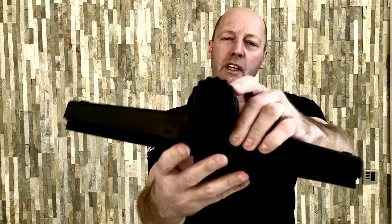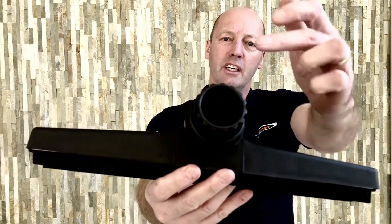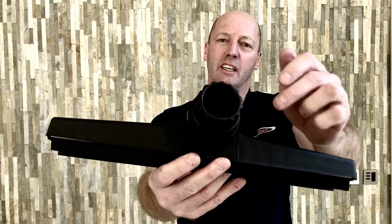On the actual inlet itself, the diameter across the centre there is about 38mm. When you actually push it onto your wand, this wand is actually about 35mm and it's beveled, so that will just slide on and then it locks on just purely by the pressure as it gets wider